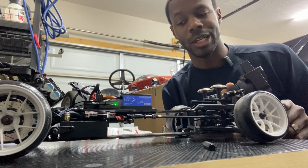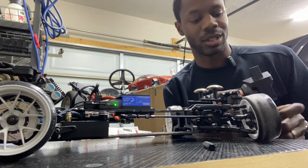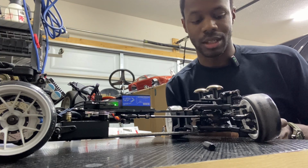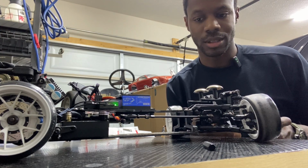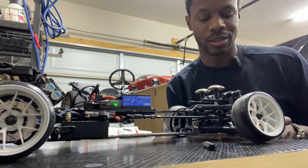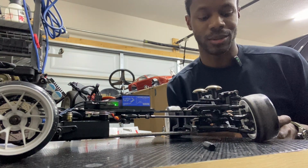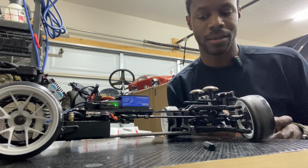Here, you need to adjust your steering endpoint. I am doing this via the gyro now, and if you look slowly, it's getting a little bit further to the left. It's dropping down the chassis. And then I'll end up letting go, and then you'll see me recheck to make sure I have the perfect EPA set, so that I'm not straining my servo first of all, but also I'm maximizing the effort that I put into the left steering and then also into the right steering.